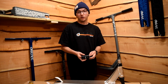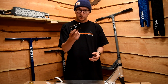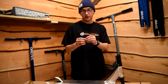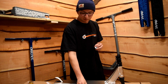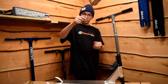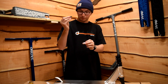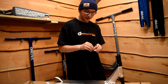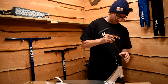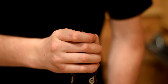Next, with your SCS, take out the bottom shim — you don't need it because you already have the shim on the fork. Slide the SCS over. Then take the cap from the SCS, not the one from the fork — the SCS cap is a bit bigger and fits better. Normally SCS goes one way, but here we're turning it upside down. Take the six mil bolt, because the inside of this fork is six millimeters, put it in, and make sure it is nice and tight. Make sure everything's in line and the headset is nice and smooth. Part one is sorted.